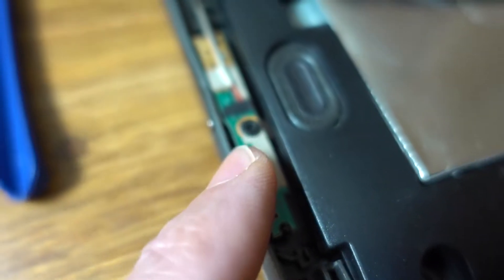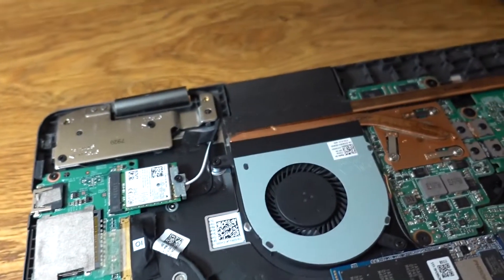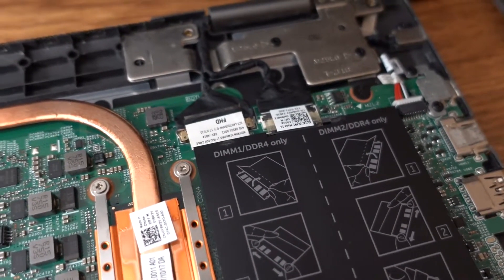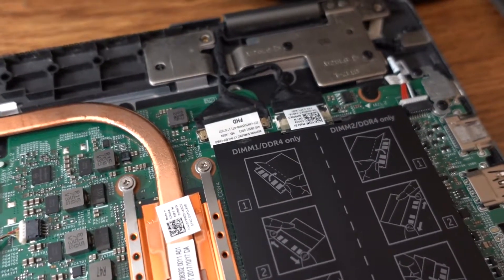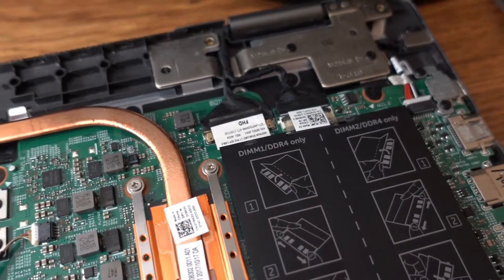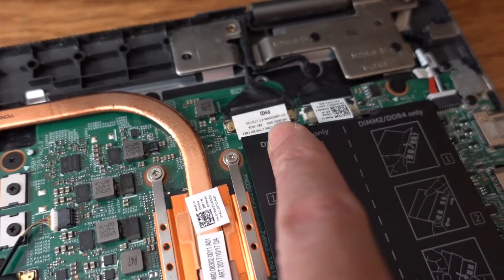So I'm going to remove this and try to force it down. What we're going to do is remove the LCD and unplug it, then hook it to another monitor to see if the computer still acts funny or if that fixes it. This thing has a touch screen, so when using it with a mouse, the mouse starts acting funny — and since the screen is all busted up, we think that might be affecting it.